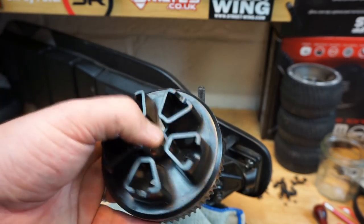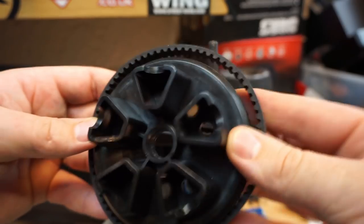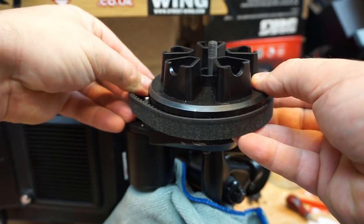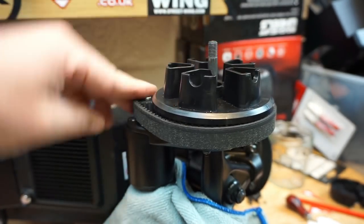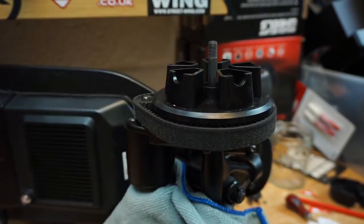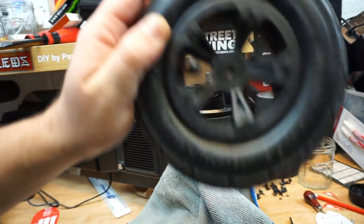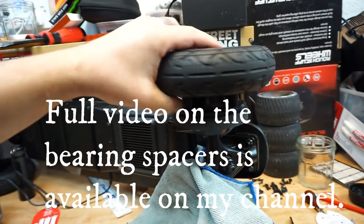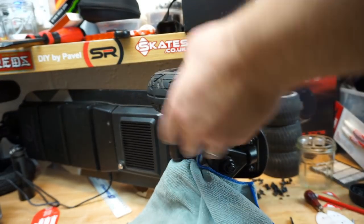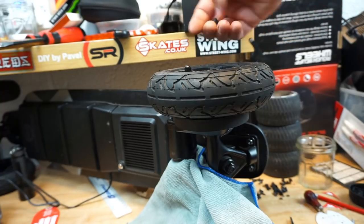Providing you've drilled out the middle of the Evolve AT kit's pulley, she'll go straight on — no problem at all. Put the belt over the Evolve wheel pulley, put everything on the axle and catch the teeth on the motor pulley. It spins nice and freely. Then take the Evolve wheel and fit it, providing you've already inserted the bearings and spacers. Remember, there needs to be a spacer between the bearings. Position it on the axle and press everything together.